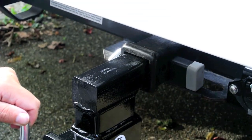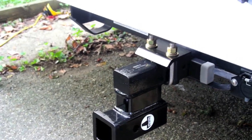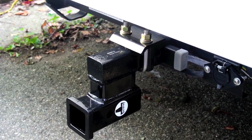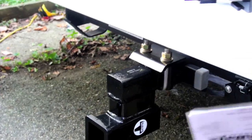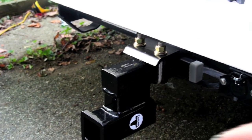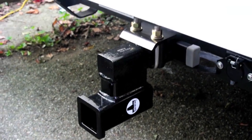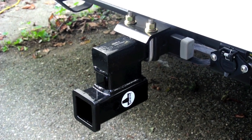I'm going to try to install the Blue Ox one at the top and the Stowaway one at the bottom, because the top should be a little more permanent. Unfortunately, the Blue Ox immobilizer would not fit between the drop receiver and the coach's hitch — there just wasn't enough clearance. The Stowaway did fit, but only upside down from what was recommended. That said, it doesn't really matter because it's not adding structural integrity, it's just keeping the thing from wobbling. And it is tight — you can't wiggle it at all. So we're going to put the tow bar on and see if the other one will fit.